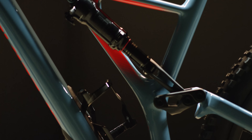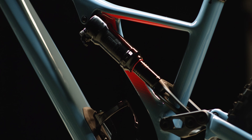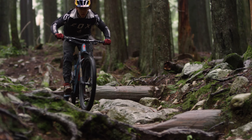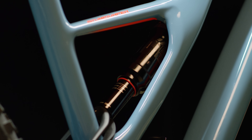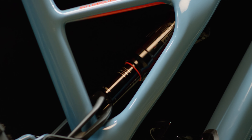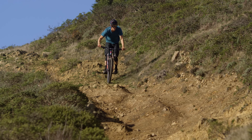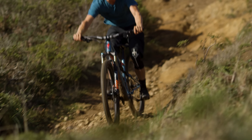The all-new FSR design provides the best combination of absorbing impact, pedaling efficiency, and active suspension under braking loads. Frame kinematics and shock tune go hand in hand for suspension performance. With the all-new FSR, we've probably got one of the best balances we've ever achieved front to back, and the system is really designed around the new shock absorber and air spring technology in the market today. The Stumpjumper's leverage ratio manages impacts with shock spring instead of relying on compression damping — key to achieving consistent suspension movement throughout the whole travel over a broad range of trail events.